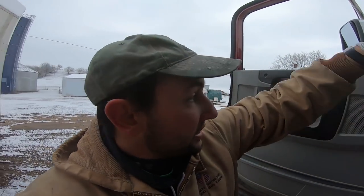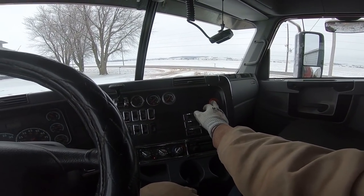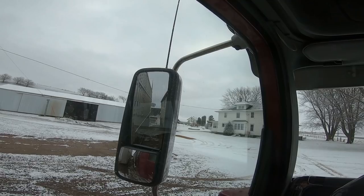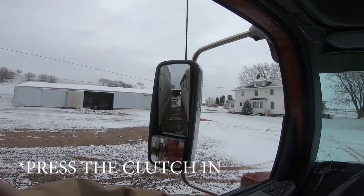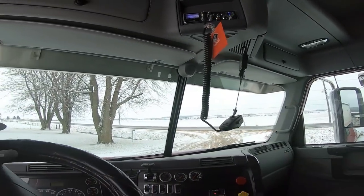All right, let's head out, pushing both brakes. The truck brakes are the yellow and go off almost instantly. The trailer brakes are the red and take about five to six seconds to release if they're not frozen — they might be frozen since they've been sitting outside near freezing. In wintertime when you're pulling away for the first time, always double check your wheels are free. I pull ahead and coast — if I stop right away I have a wheel locked up, but if I keep rolling I'm good. I'll pull over, put some air in that back tire, and get the snow off.